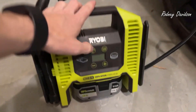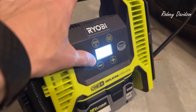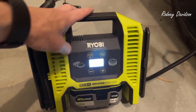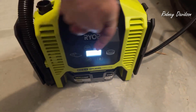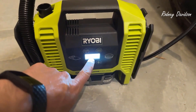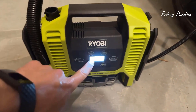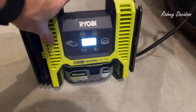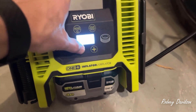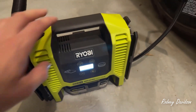This is the power and the mode button. You press that and it turns on — it'll take a second. Right now it shows 29. If you press the mode button, it'll point an arrow. You can't see it unfortunately, but it's pointing that way, so that's how you know it's on deflate mode. If I press that again, it shows an amount it's going to inflate to with an arrow pointing the other way, so you know that's inflation — that's the side I want. All you do is increase this to the amount you want. I'm going to set it to 39 PSI. Then you just hit the start button.